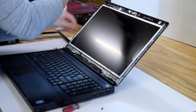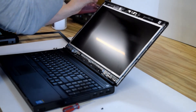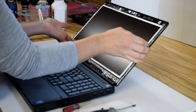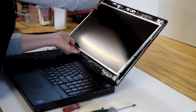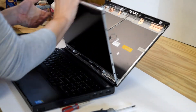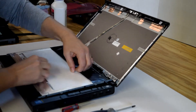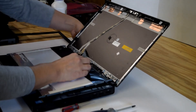The screen has got a retaining bracket on it, which you're going to see as soon as you pull the screen out. The screen that you're going to use as a replacement — if you purchased one or took one out of another laptop — it may or may not have the bracket, so you can use the previous bracket.